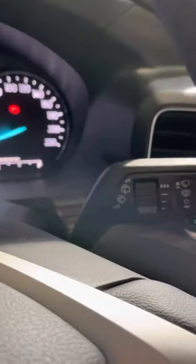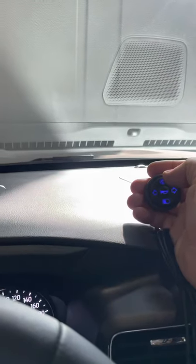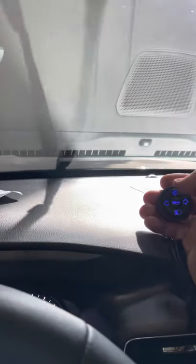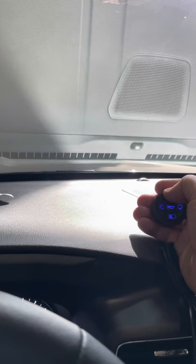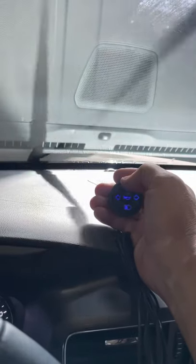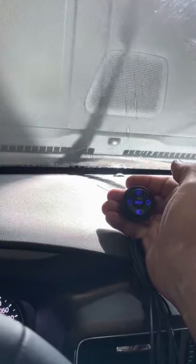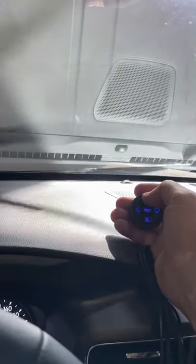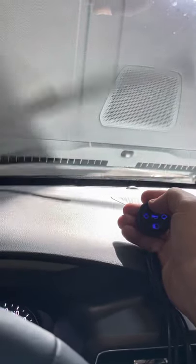In the factory you can use it normally. So here we have the intermittent — now it's waiting for the car to move or for rain. If I press again, I get the normal wipe or low speed, and the rapid wipe which is high speed, then off. Press and hold for the wash using the same switch. You can wash even while normal speed is working — press and hold, the system will wash and continue as normal. Same with high speed, it will drop to low speed, then off.